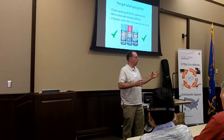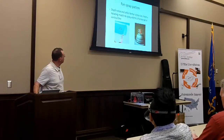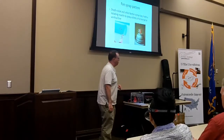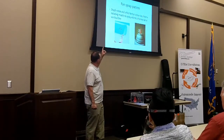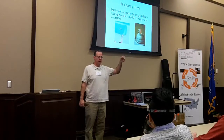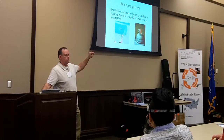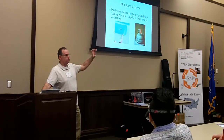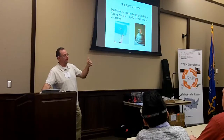Spraying metal flake poses an additional mastery-level technique challenge — getting the metal flake laid consistently, evenly flat, and uniform in appearance. It's not the same as spraying a solid color paint. Definitely practice, practice, practice on all of this. Good cans of paint are going to have a fan pattern much like a spray gun. Duplicolor does this too — there's a little plastic insert on the nozzle that you can rotate to change it to a horizontal or vertical fan line rather than a circular spray pattern.